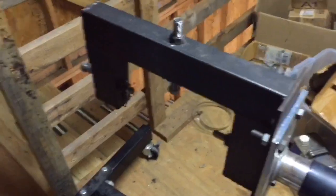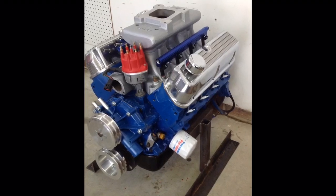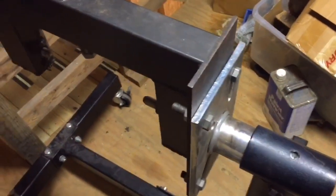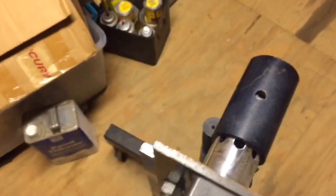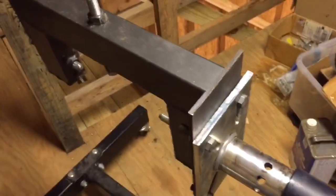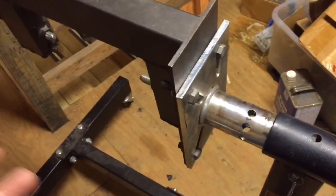You could pick up the transmission with this. You can actually leave this part of the engine stand on the transmission fixture while you're working on it, while you're lifting — it's not in the way and it actually works out pretty good. I'm trying to do this with one hand — kind of a snug thing. But the idea is you would lift it up, this spigot would be on the fixture, and then you can basically maneuver the stand onto it with the transmission and then set it on the ground. Pretty simple.